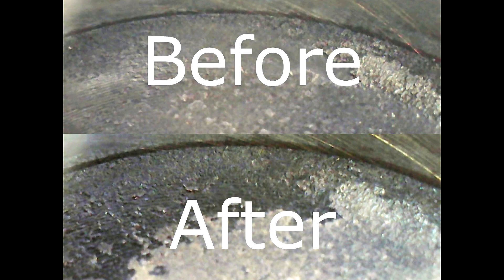So let's go check out to see if there's anything in cylinder two. When we first look, this actually looks pretty good. Let's check out the before and after. Before and after looks about the same. The carbon chunk on the right does look like it got a little bit smaller. And you can kind of see when you compare the before and after that some of the carbon is getting reduced. So we're not getting anything significant, but we are getting some carbon reduction.